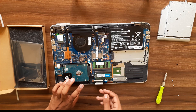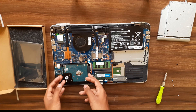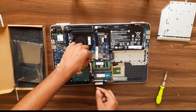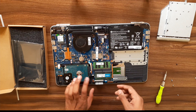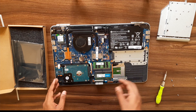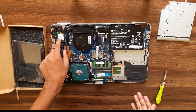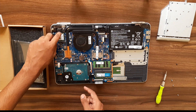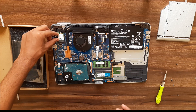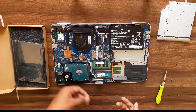One more thing — the hard disk is also replaceable, but for that you need to take this connector off first. I'm not going to do that today. You can also replace the Wi-Fi module — it's the same as small SSDs. Just remove the screw, pull it out at an angle, and you can replace it, though most people won't be replacing a Wi-Fi module.